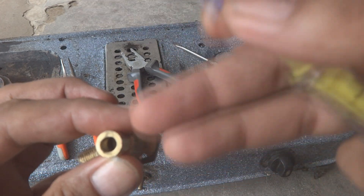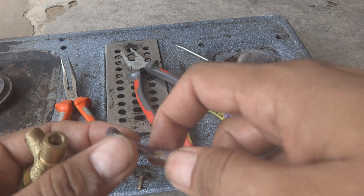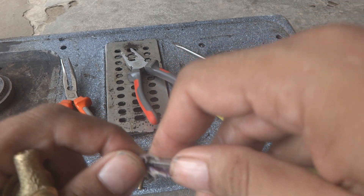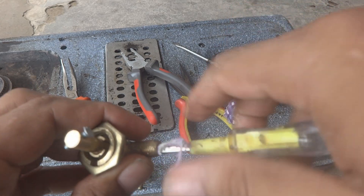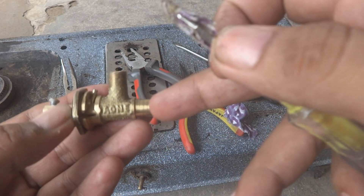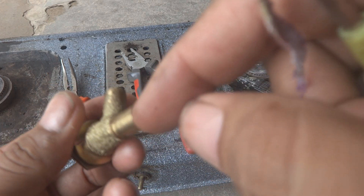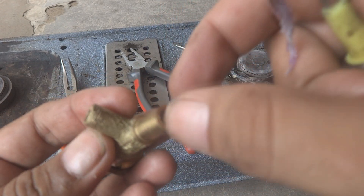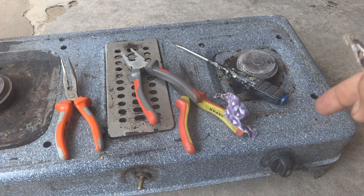This is very important. If the grease is still there, it will be restricted and you will not get proper gas flow, and the burner will not switch on properly. We have to do the same thing with this valve — all these two passages where the gas flows, we will have to clean. Also, inside these threads you can see there is a small nozzle with a small aperture. That nozzle is inside this older valve; we will remove it and fix it.